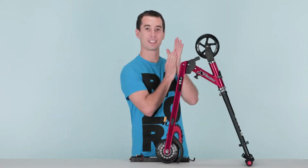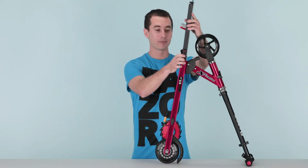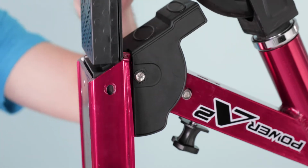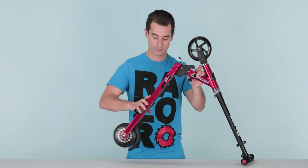Now on to step 4, reinstalling our controller tray. Now you need to grab your scooter back. Take your tray and slide it straight in from the top. Make sure you depress the power switch so it will fit in the frame. I like to open it back up to make it a little easier for me to work on.